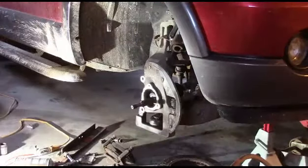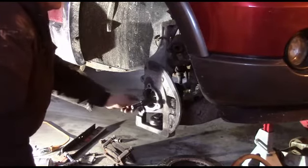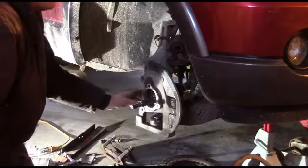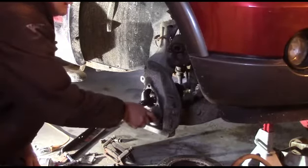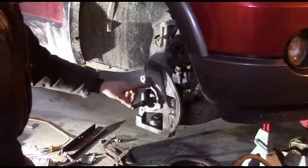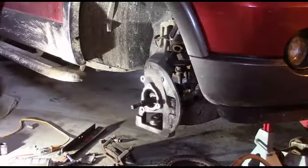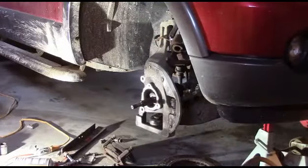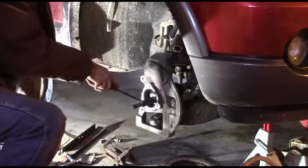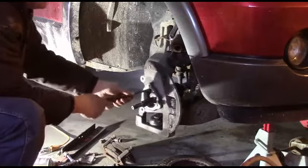I got my new part and decided to start cleaning up the old part. When I used a chisel to separate the bearing hub assembly from the steering knuckle it got all boogered up just a little bit, so I took a die grinder and very lightly took off the little bit of deformed metal. It was quite easy to do, and then I realized this steering knuckle is aluminum. So we've got to be a little bit careful. There is a certain amount of corrosion in there, so I'm just going to carefully scrape that out without gouging up that aluminum. There's some white-colored corrosion in there, as there so often is when aluminum is touching steel.